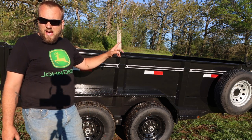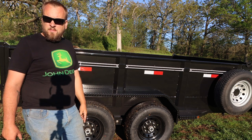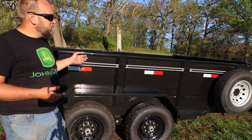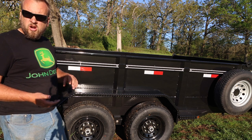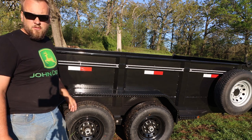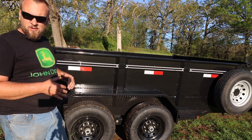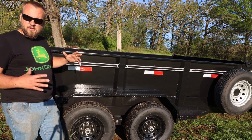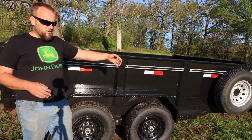I'm actually a little lower than that because I have a half-ton truck — a 2019 Ram Limited with a rated tow capacity of just under 12,000 pounds. With a 4,000 pound trailer, I can put 8,000 pounds in it, which is 4 tons. This trailer filled across the top is 6 yards. A yard of rock weighs about 2,500 pounds, so this thing could have 16,000–18,000 pounds in it if you filled it with crushed rock. You have to be careful not to overload it — especially with dense material — not only for your vehicle but also for the bed to be able to dump.